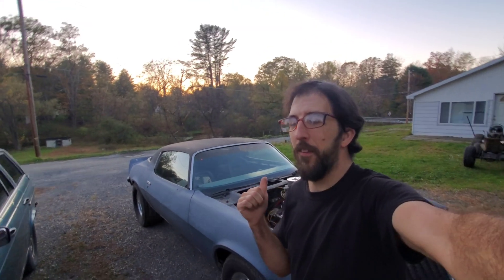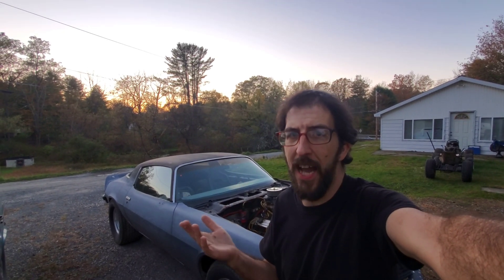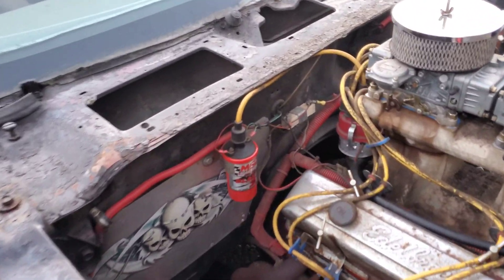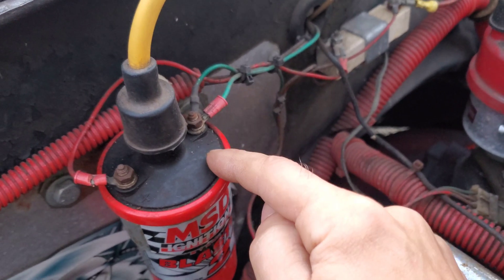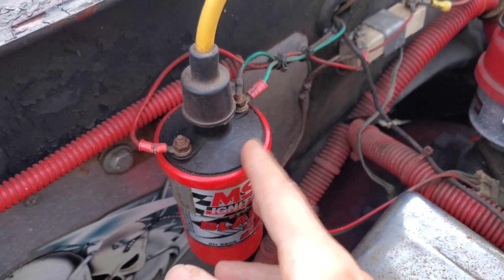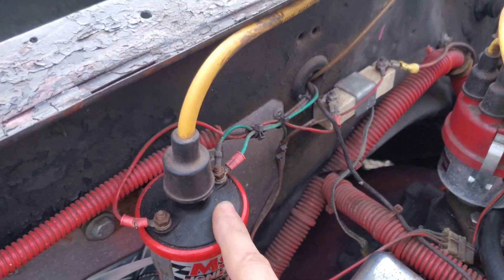I'm filming this completely out of order, just like a real movie. Let's take a look at this 12-volt electronic ignition setup, because if you do have an old Kohler, I wanted to show you real quick how you would hook a tach up to that with a standalone coil. Your typical 12-volt ignition with a standalone coil has a positive and negative on your coil, and your tach signal is going to come from the negative side of your coil. Some of the real old-school Kohler single cylinders will have a setup just like this - green wire going right to that point. That is where your tach signal is coming from.